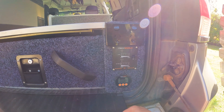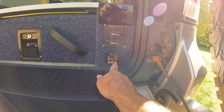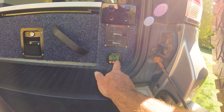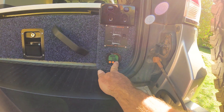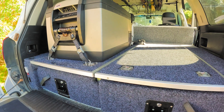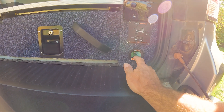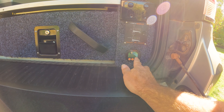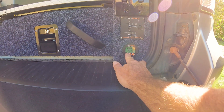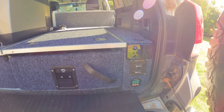This is the iTech World Battery Monitor — this one's awesome. We've already got it programmed in for a 200 amp hour battery. We're sitting at 80 percent at the moment. You can reset that by holding the button once your battery is fully charged and it'll take it back up to 100 percent. The middle display shows amps going out — currently sitting at zero amps, so we're not using anything, the fridge is just sitting at idle. We've got 161 amp hours remaining in battery capacity.